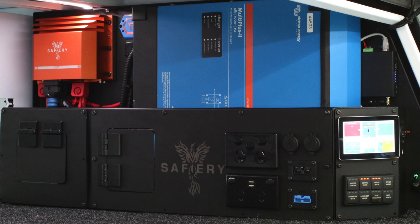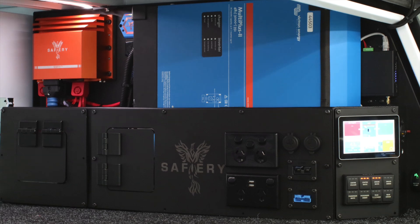The switches on the front are for 240 input, solar in at the bottom, and an additional Anderson plug out. It's a 3000-watt inverter here, and you'll see the Starlight between the Scotty and the inverter up at the top. It has little LEDs so you can see the circuits and manually turn them on. The Starlight uses smart MOSFET control with German chips — MOSFETs on a chip — so it does not need any individual fusing from the Starlight going out to the lights.